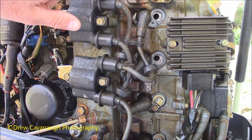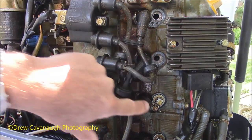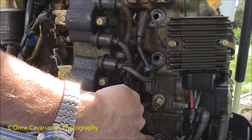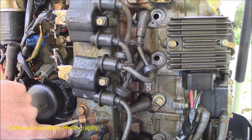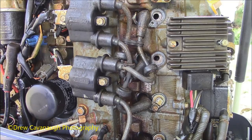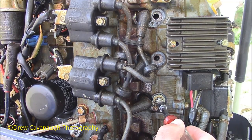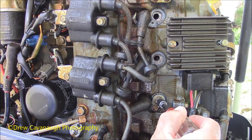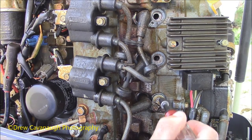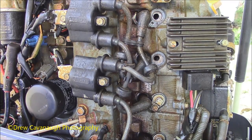Right here on this particular outboard, I've got five of them. There's one on each side of the spark plug here, and then there's one right down here. Basically what you do — I think it's a nine millimeter on this outboard, it's an eight millimeter — to remove the anode, you remove this bolt and this little cover moves to the side.